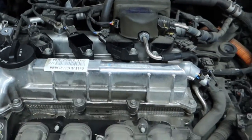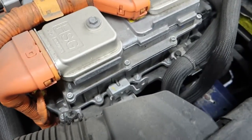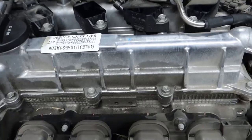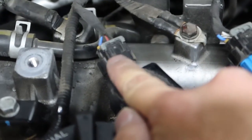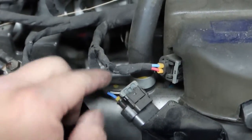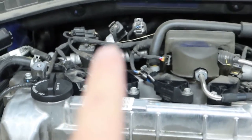Here's your engine — this is the combustion engine. I'm not too good with hybrid stuff, but there's like a motor there. So here's your coil packs. We're going to take those off. Now there's a locking tab here — you just pull. It's not very easy. So your locking tab comes up, then you can push the black part down and it comes right off. Again, that locking tab is the harder part.